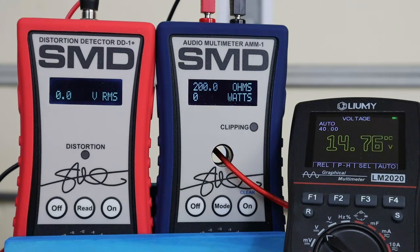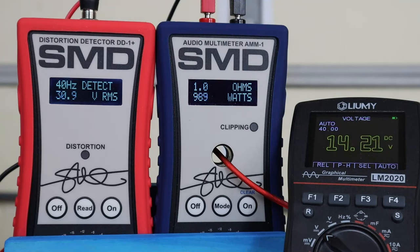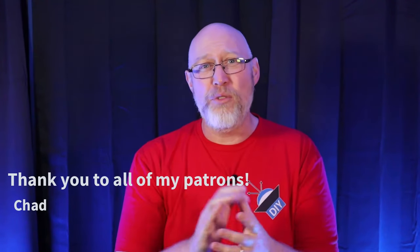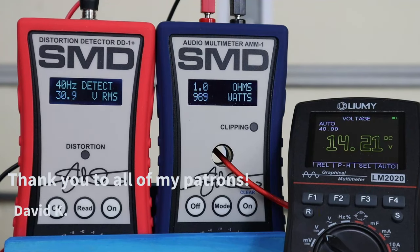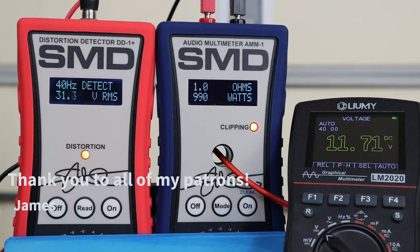We are all set — let's see what happens. We get 1% THD at 989 watts, so we get at least 48 more watts just by increasing the battery from a 900 CCA to a 950 CCA. Look at the voltage — we're at 14.21, and then right when we hit distortion we drop down to 13. Running it up to clipping we get 990 watts at 11.72 volts, which is roughly the same result as before.